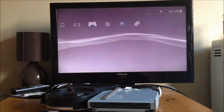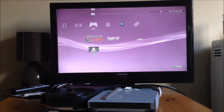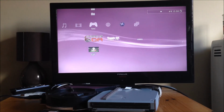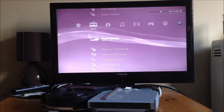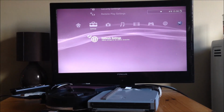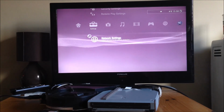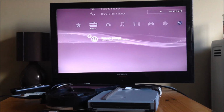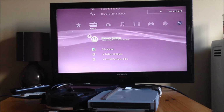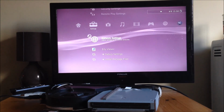See, because of the downgrader, the syscon is set to 999, so you'll only be able to install firmware of 999. So what Toggle QA does is it resets the syscon. So if you come across to settings and go down to the bottom, go to network settings, and then you want to press L1, R1, L2, R2, click the left stick in and down on the D-pad all at the same time. I will write the button combination in the description as well, and it will be in the written tutorial. So if you press all those buttons at the same time, you should get this menu pop up underneath, which is EDY Viewer, Debug Settings and Install Package Files. So you should get that pop up underneath Network Settings.